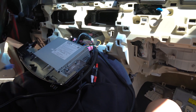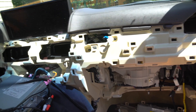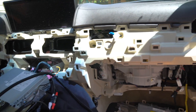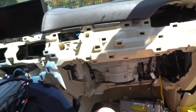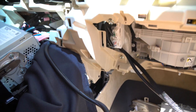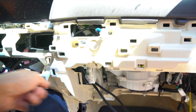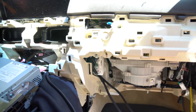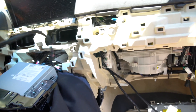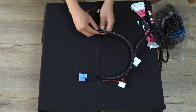We've already cleaned up our wires a bit. We want to route some wires to the glove compartment area and some wires to the monitor area. First let's start with the mic cable, the aux cable, and also the main harness. We'll route it through and behind here — it's going to come out over here. We went ahead and routed these two wires: the main harness cable along with the aux and the mic. This area is a bit tight so you might have to do a little maneuvering to get from behind the radio to here. Be very careful that you go through the right opening and don't put any pressure on or cut the wires. If you want to clean your wires up, refer to the other video — I'll have a link below.